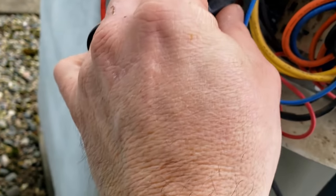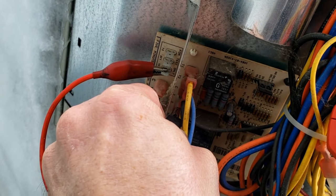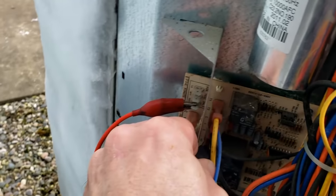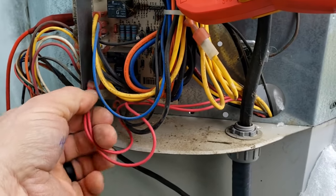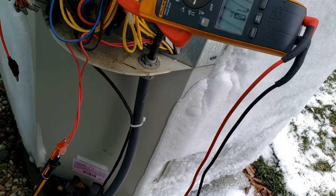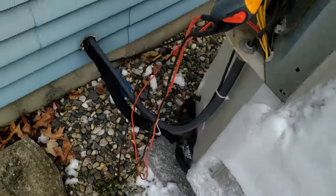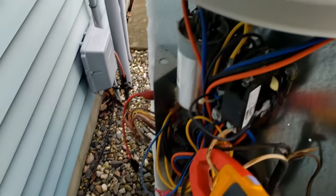I'm not sure that'll work — it doesn't want to go into defrost again, which means that stat has already opened up. Let's take a look at that stat and see if it's open. According to that, it is open — so our stat is prematurely opening up. Looking at where it is: it's a red wire, probably down here in the very bottom corner. Let's see if we can get this thing melted some more. We'll go ahead and jump the stat out — that's our problem, I think. It's prematurely doing its thing.